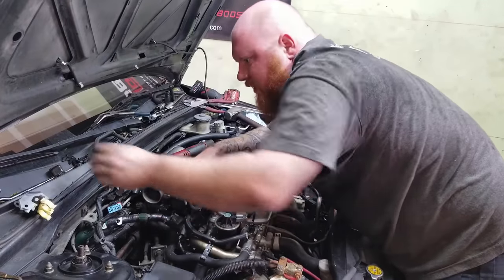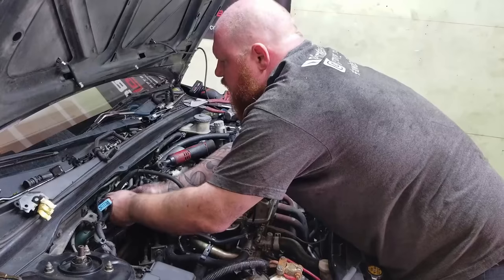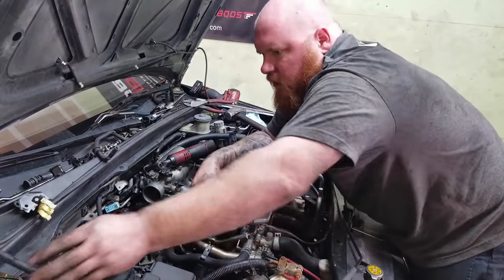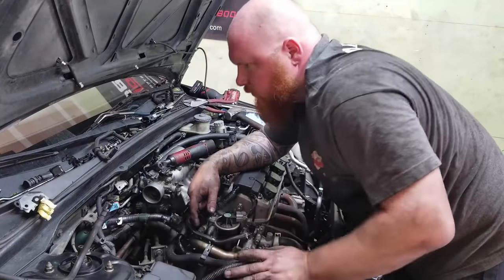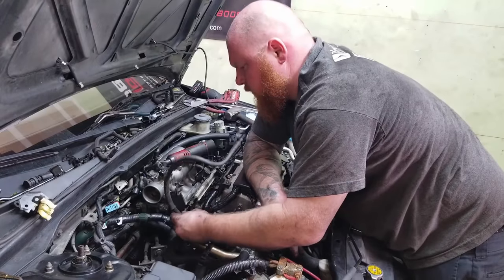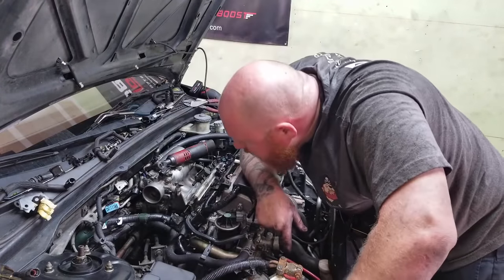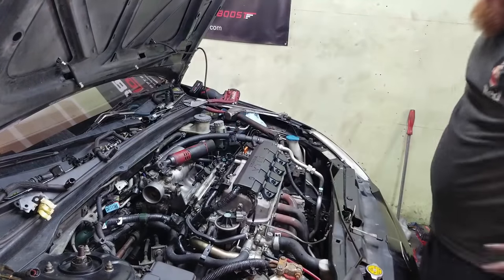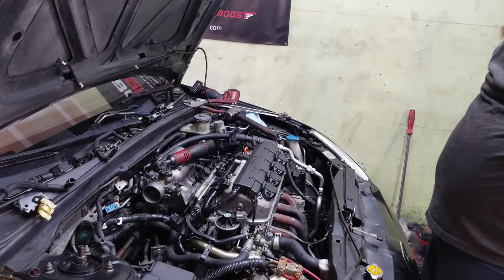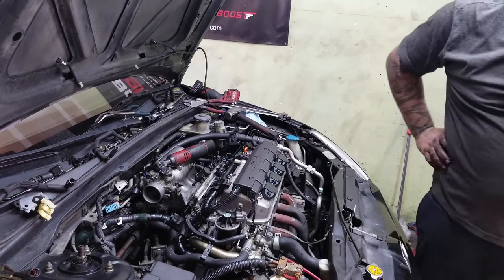Now I can get that off. That's it. So this fuel line just disconnects, and then we can change it with like an RSX one, because this fuel line is way too small. Because if you look at this one, now this still doesn't even fit. Was that a 5/16 on the fuel rail? Should be. Well, here, I'm gonna go look for some parts.